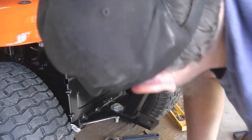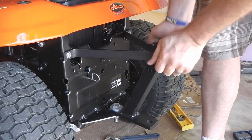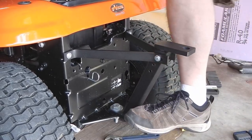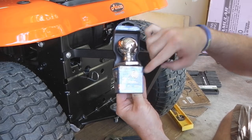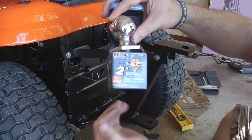You can now see how much stronger that is — watch down here, see how the entire rear end flexes, not just the bottom piece — to the point that I can actually stand on it. I just went to Home Depot and picked up a Reese two-inch ball. The key here is that it has to be a three-quarter inch shank.